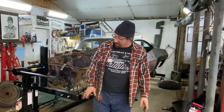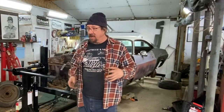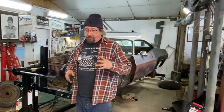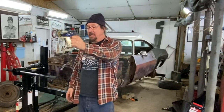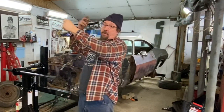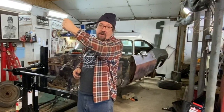But it's out. I'm exhausted. My arms are falling off. There really wasn't any good way to film because I was afraid I was going to break my camera if I had you under there. So what I did was I took everything off to be sure. I don't think I really needed to drop that upper control arm, but I did anyway. And then I took a hammer inside the torsion bar in the back and took another hammer with safety goggles because hammers can explode. You shouldn't hit a hammer with a hammer, but that's what I did.